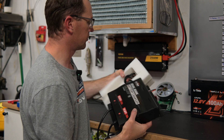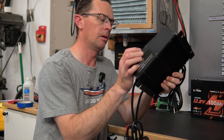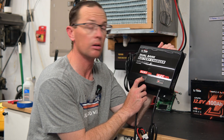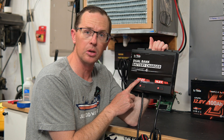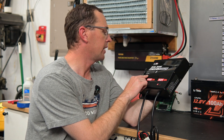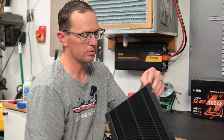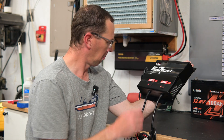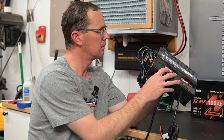What's nice is we've got one single footprint on the boat for charging batteries. It's got a button that selects LFP — that's your LiFePO4 — or NCM/NMC, which is nickel cobalt manganese, and lead acid or AGM. So you can run a 36 volt trolling motor battery and an AGM cranking battery on different chemistries. It has a total output of 584 watts, it is waterproof with IP65 rating, has a nice heat sink, and it does get hot so don't touch it when charging.